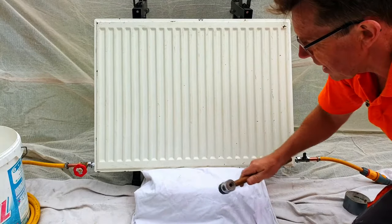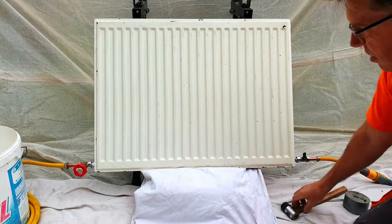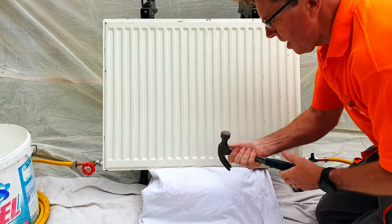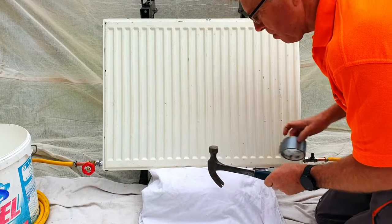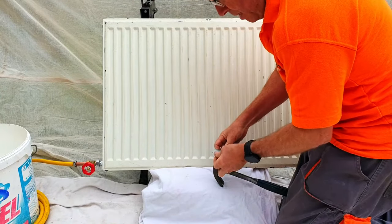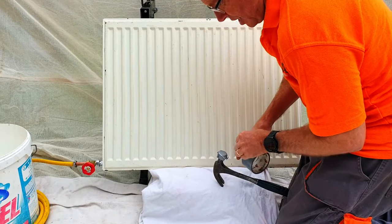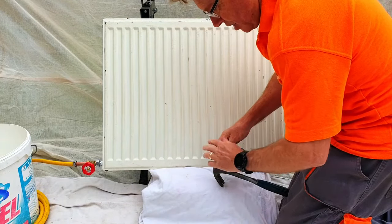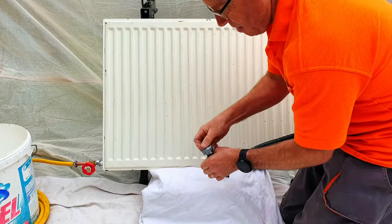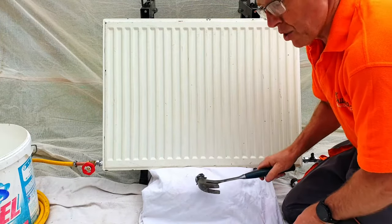Then what I'm going to do is bang the bottom of the radiator with my rubber mallet. I'm going to bang along the bottom — that's going to vibrate the radiator and dislodge more of that black dirt to get it out. If you don't have a rubber mallet, you can use a normal hammer, but what I recommend is you protect the top of the hammer by putting some tape on it like this, to make that hammer end soft so it's not going to chip your paint. Having said that, there's a good chance if you go whacking your radiator it might chip it anyway, but this is the best way to remove that dirt. With the softer finish you can just tap the radiator and dislodge some more of that dirt.